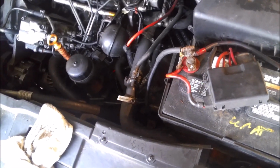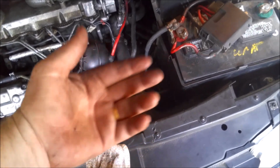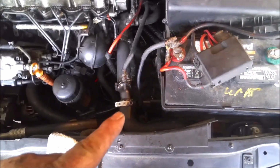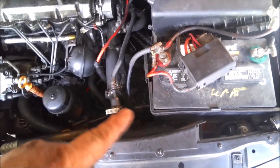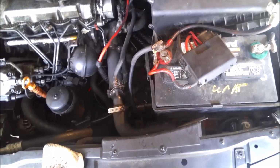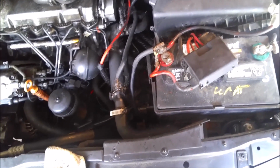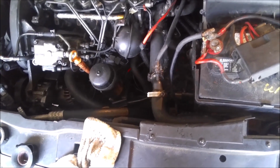Sometimes you get lucky, but visual inspection on this car would be pretty rough. Pulling that out, like I said, it's under the battery tray there. So anyway, we followed the wiring diagram, checked powers to everything first, and then we started getting a little deeper into it, found that wire, and obviously it was corroded. So anyway, that's about it on a VW.